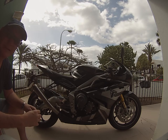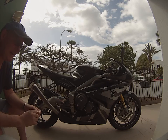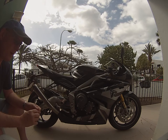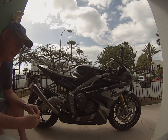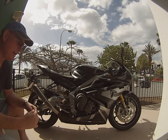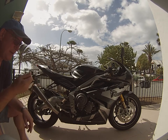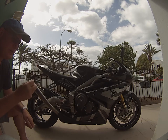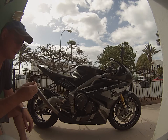And the front was easy because it's the big piston forks, so that's done with an Allen key, and I didn't know what I was doing, so I just put another couple of clicks, mainly down to my weight, because after reading all the reviews and everything else, they're always set up for a lighter rider, apparently. So, the reason I got the Allen key is because I clicked it back, I think, one notch from the factory sport setting, so that was soft.